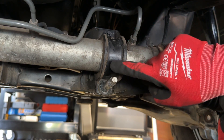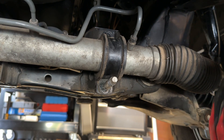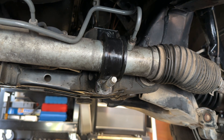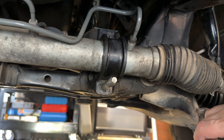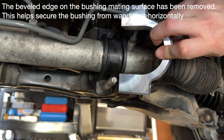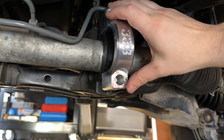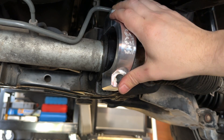I'm just going to clean up this bushing since there's a little bit of debris on here, and then we'll get the 333 Fabrications billet clamp installed. If you want to watch an instructional video on how to replace the steering rack bushings on your third-generation Toyota 4Runner, click the link above. The orientation you install this will be vehicle-dependent. With my particular setup on this 2002 Toyota 4Runner, we installed the clamp with the longer side facing down.